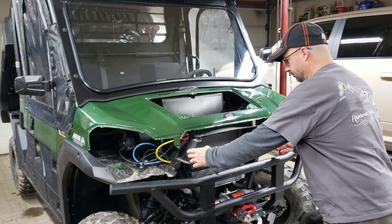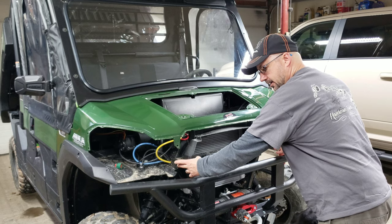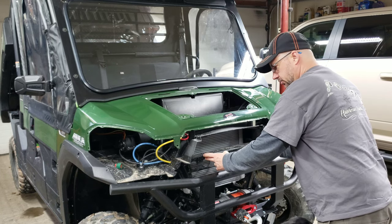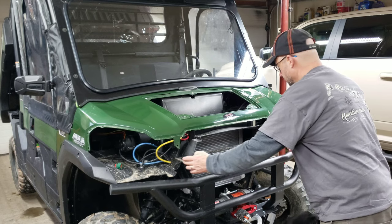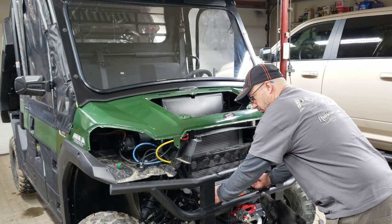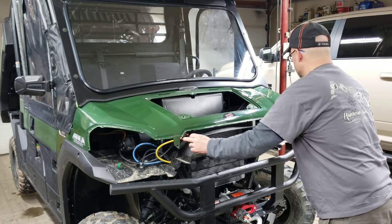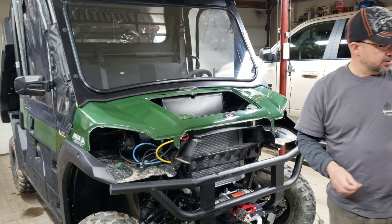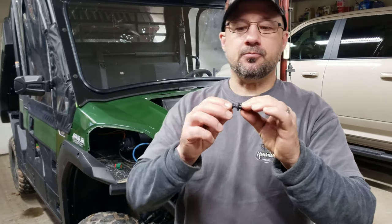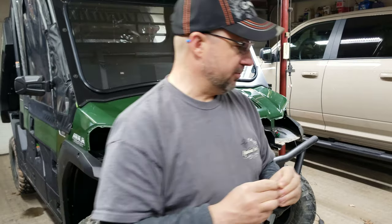So you have just inside of your factory, your inner headlights, the optional ones on an LE model. And then you have the center bar of the grill. You have these ones. Those are screws. These are screws. And then down here on the frame, there's two more. So you have six. Two, four, six, right? Everything else, what I showed you earlier, are these little plastic body clips, body pins, whatever you call them, body rivets.